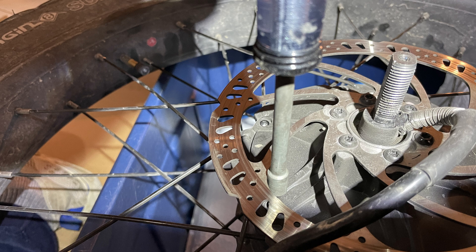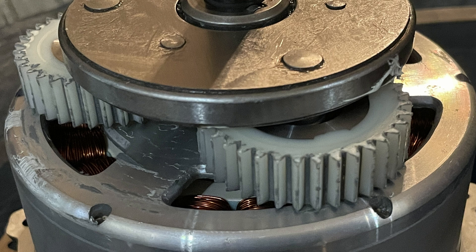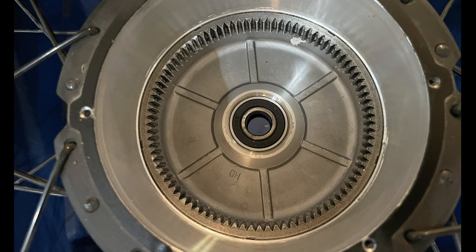I've seen people use metal hammers — I certainly wouldn't do that. A plastic or a wooden mallet might be necessary. The planetary gears came out along with the motor and could now be examined for wear and grease. Some videos have shown a thin washer left in the bottom of the motor housing or that came out with the planetary gears, but I didn't see one on mine. I didn't notice any wear or debris on the gears inside the hub or on the nylon planetary gears.